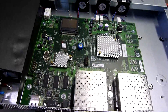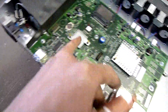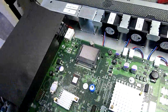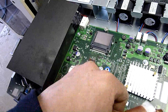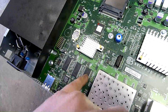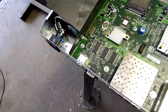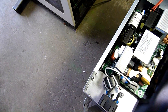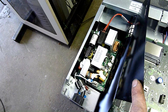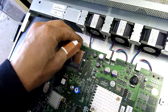Unfortunately there isn't a lot to see inside because it's pretty much one main chip — looks like an interface, and that's about it. It does seem to have a memory card in there. There's a bootloader, so this will actually run an operating system of some description. We've got three Infineon 256 meg RAM chips, so it's running 768 meg of RAM. There's a Delta PSU supplying 12 volt at 6 amps — just a single voltage switch mode power supply, decent quality Delta one.